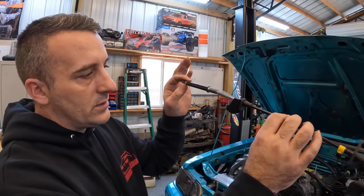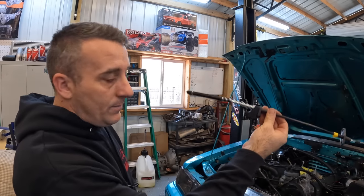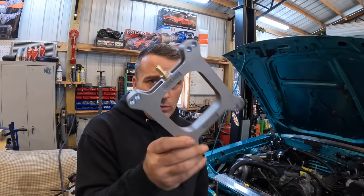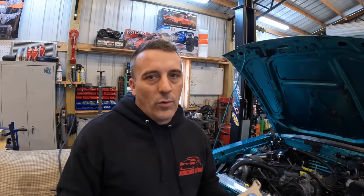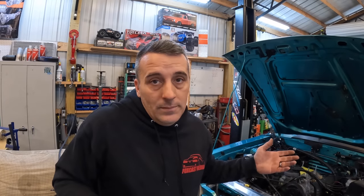Remember, this is an 82 to 86 throttle cable, and that's pretty much it. It's gonna mount to our bracket that we've got. Good to go. I drilled and tapped a hole in for a little barb fitting on this spacer right here, because I thought about it beforehand, but then I forgot and I installed the intake, and I really don't have a good spot to drill my intake just the way it's made.